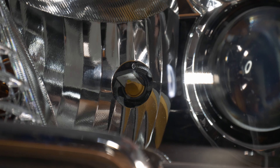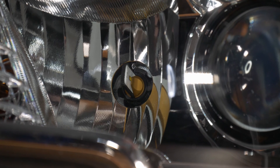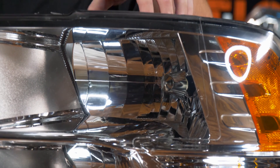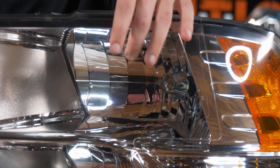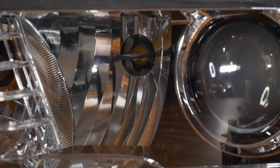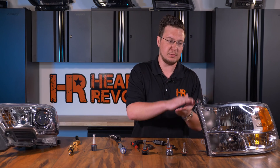Whenever you get it installed, you'll want to install the LED chips at nine and three o'clock. Looking at this Dodge Ram headlight, the reflectors inside on the low beam are more prevalent going horizontally. If you install the bulb up and down, instead of light shining off all of those reflectors, it's going to shine off the chrome inside and produce a terrible beam pattern. That's why proper orientation is so important.